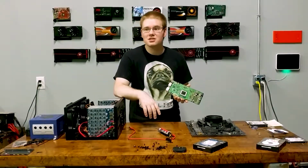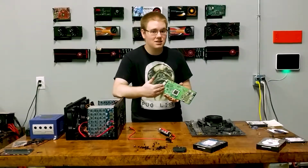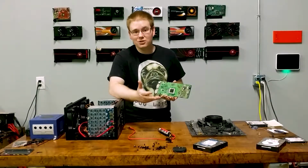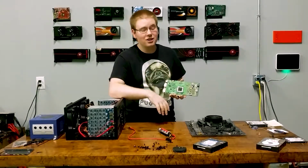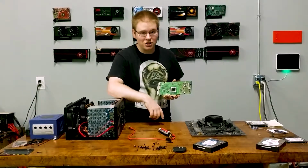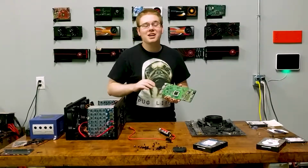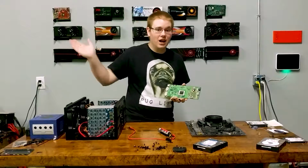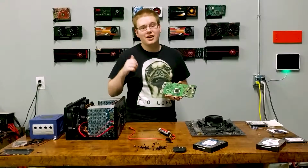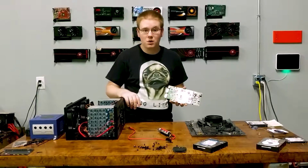Now, one other thing to consider is because it's running 24/7, the rate of erosion per hour isn't as bad, but it's a lot more hours, so there is that to consider. So because the voltage has been decreased, the card should theoretically live longer in that regard. However, I have not been paying for air conditioning. Not that I'm not paying the electric bill, I am. But what I mean is I have not used any air conditioning, I've just been blowing air through the room. As a result, the air has gotten over 100 degrees, which means the fans on my video cards have been working harder than normal, and also 24/7.